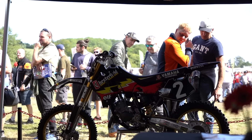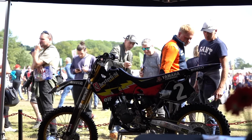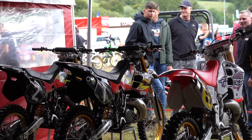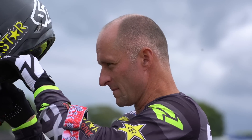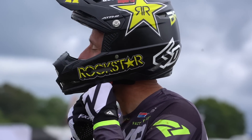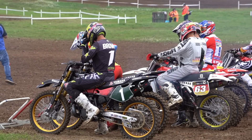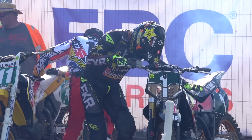Then I thought we need some spares, so we bought a 250 for spares. Tony, my workshop manager, built a 125 at the same time for himself because everything was off for powder coat, anodized, and Cerakote — his stuff went with ours. Bare frame, vapor blast, back to bare metal — everything is new really. As much as they look new, you're probably six hours into cleaning up the swing arm on each one. It's a full day's work to do a swing arm.